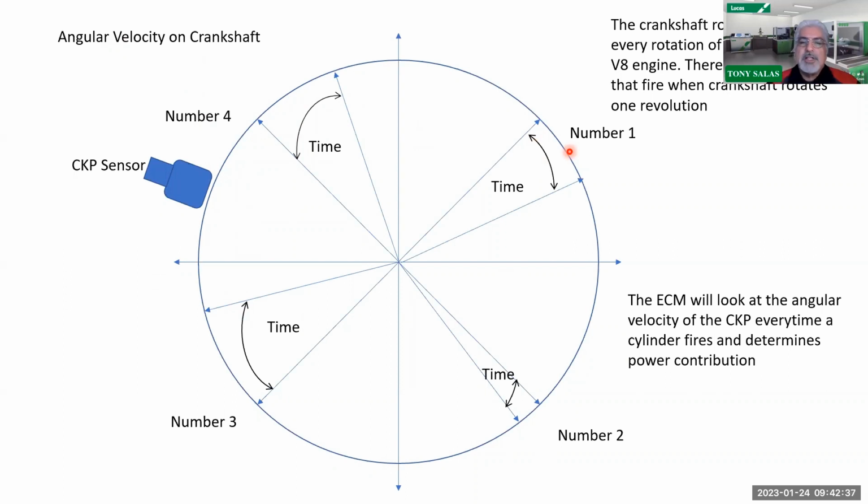So in this case, when it's running under decel at a higher RPM, that means RPM is slowly dropping, slowly dropping, slowly dropping. So therefore, if it's looking at injector timing under decel, are the injectors coming on or off? But do we have compression events taking place? So think about that for a minute.